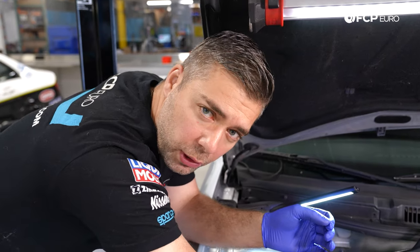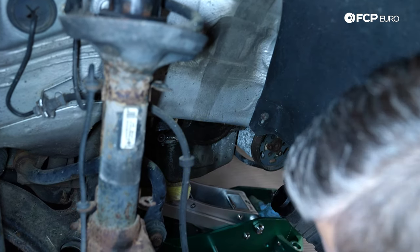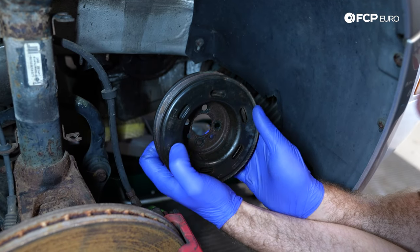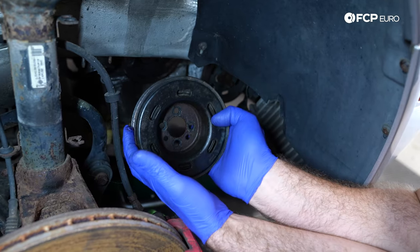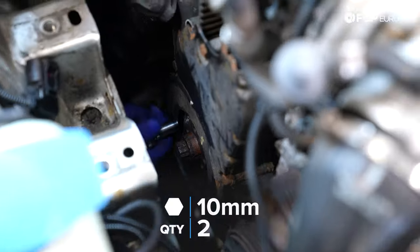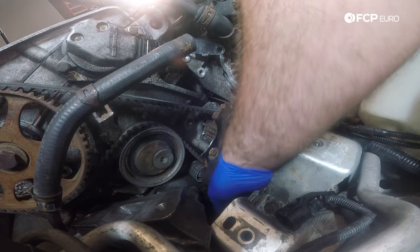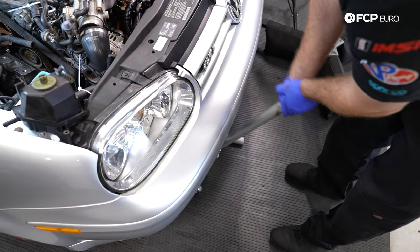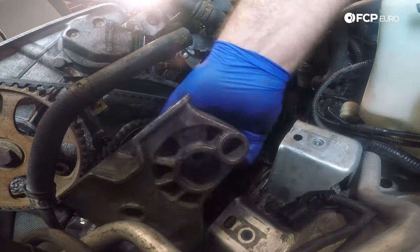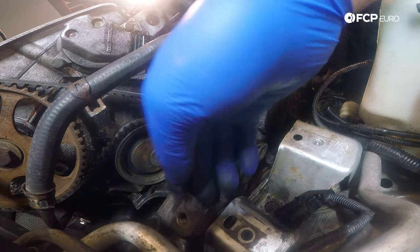There are two dowel pins that line up this crank pulley. As long as your timing mark is where it's supposed to be, there's that notch on top and then you're going to have the two dowel pins — they can only go on one way. Now down here we're going to remove the two 10mm lower timing cover bolts, and then loosen the three upper 10mm bolts on the lower timing cover. Now we have the lower timing cover off and the crankshaft pulley. We're going to go ahead and jack the motor up just slightly. Be careful when jacking up the motor — we are resting and jacking it by the oil pan, so you don't want to put too much pressure. Just be cognizant of how much pressure is being applied. We're going to jack that up a little bit and remove the bracket from the vehicle. I also removed the air intake hose that goes to the intake manifold — if you don't remove that it's going to be hung up and pulling on it, so this may give you a little bit of leeway.